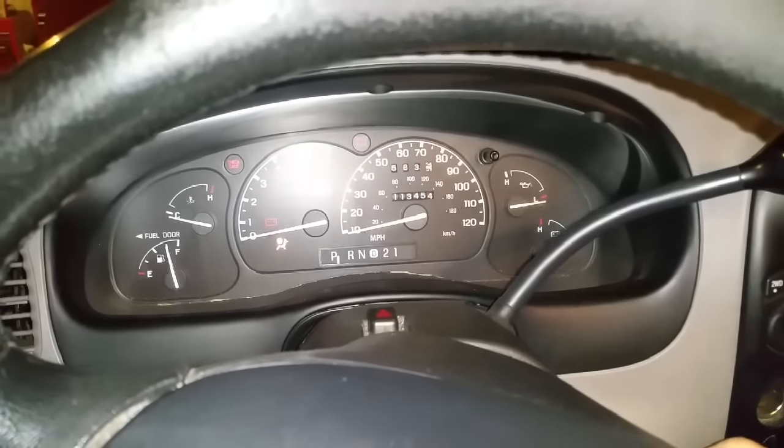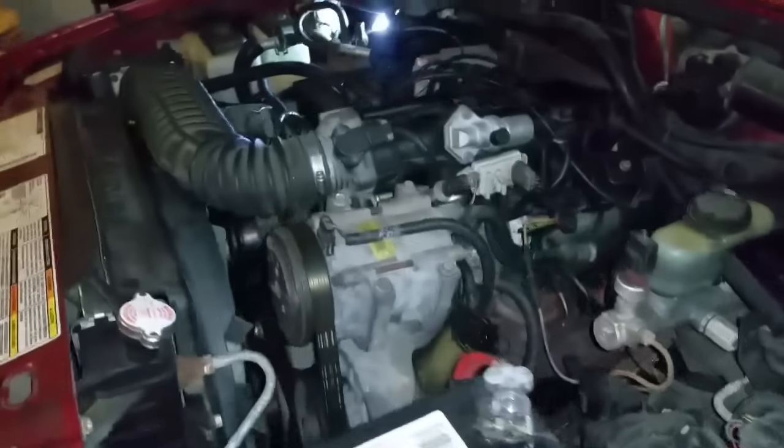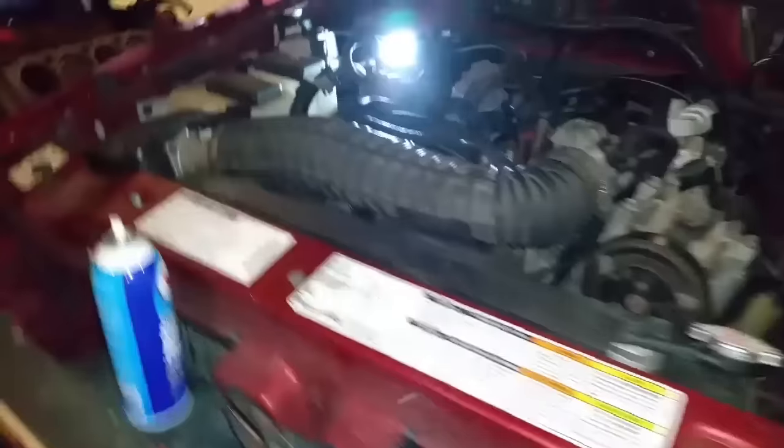So we did run for a little bit. In that situation, if you went from a completely crank no-start situation to spraying starting fluid in and it firing for a moment like it did, then you know you have a bad fuel pump.